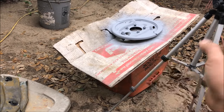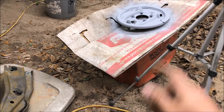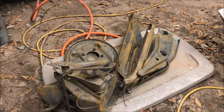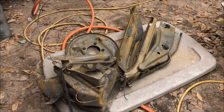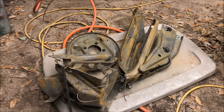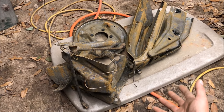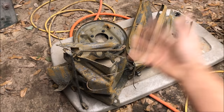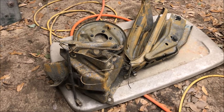We just lightly sandblasted them in the follow-up video — it takes about 5% of the effort it normally would the old-fashioned way, making it so much easier. We're going to do the same to these. Just know: you're not going to pull these out, scrub with soap, rinse with water, and coat them — absolutely not. That's really the only downside to molasses rust removal. It does a great job but doesn't get every last bit off, and then you've got to remove that residue layer. That's it for the video — if you enjoyed it, please like and subscribe. Thanks for watching.